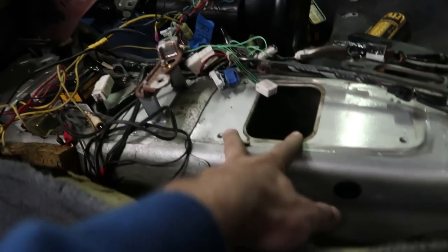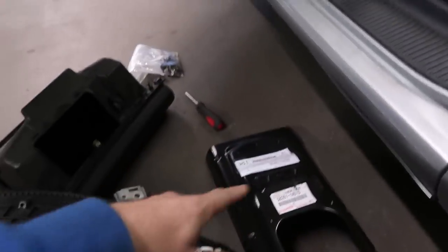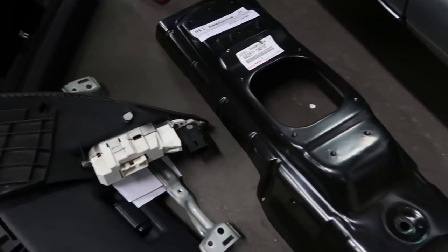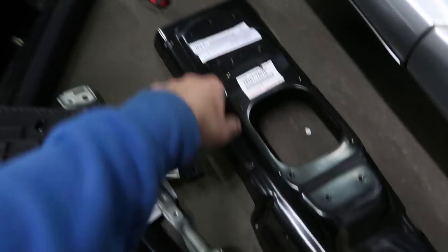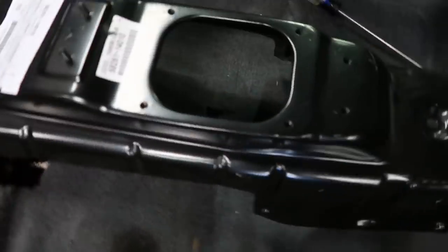See how flat it is? Remember I was telling you it's a small rectangle? That's a small rectangle, but it's really flat. So when you put the V160 trans in there, you would have just had to cut up, because this is where it would be flat down here, and just go right across down there. So you would have had to cut like this big hole out, and maybe even up here because the stuff interferes up there. But Brian wanted to do it the right way, so now we're gonna cut out the automatic version of this guy and then weld this in.